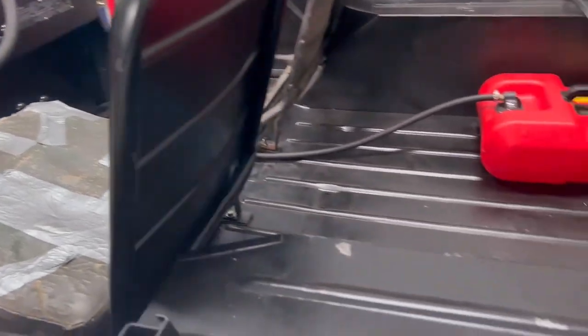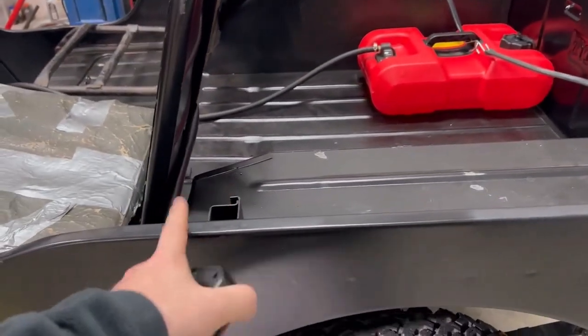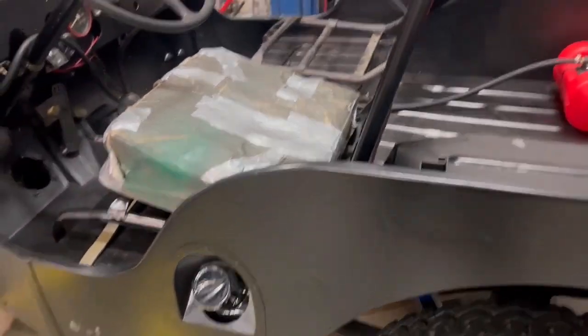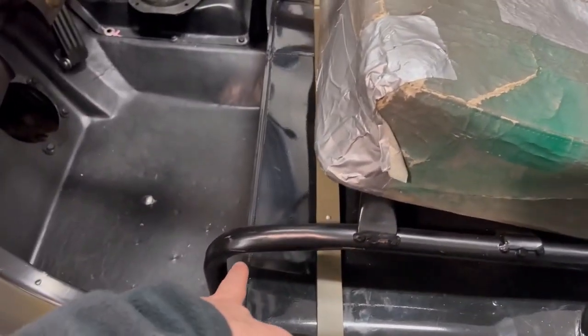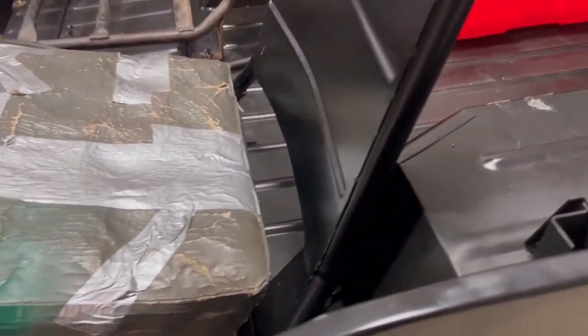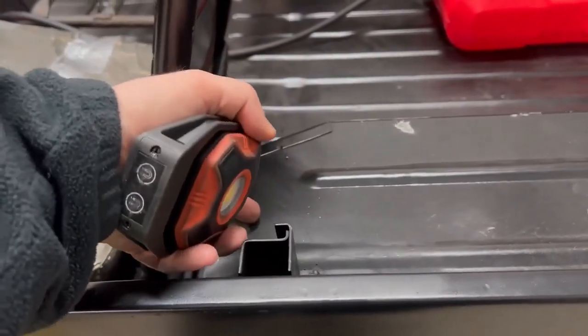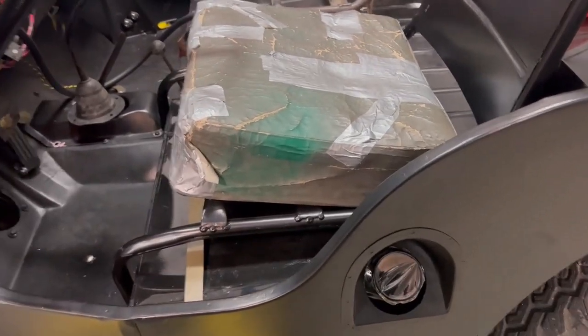It's a bummer to have to cut such a big hole in a brand new body designed for a 2A, especially when my frame is really straight, the engine is straight, and the drivetrain is all in the right spot. The rear body mount holes line up perfectly with the rear crossmember, and the fenders line up where they're supposed to. But this center section — from the PTO to the transmission tunnel — something's just not right there. One key difference between 2A and 3A: the rear wheel well is about two inches shorter on a 3A body. I have a 2A body, and this matters because of the seat.